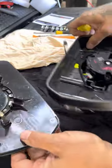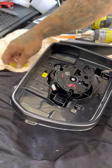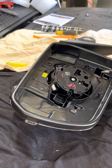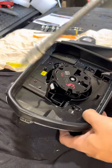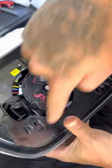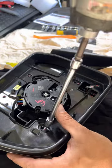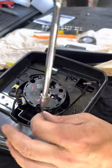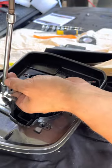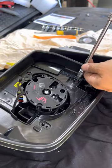That one there is your blind spot monitoring illumination component. Now if you use a T10 torx bit, you'll find these screws here — they've got little pink marks on them, meaning they've been quality tested and torqued up in the factory.